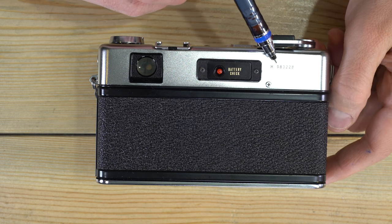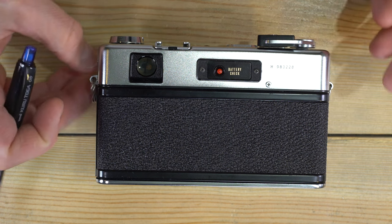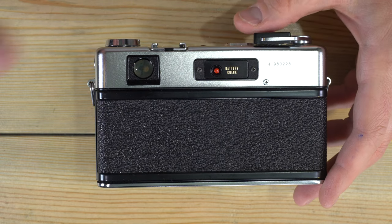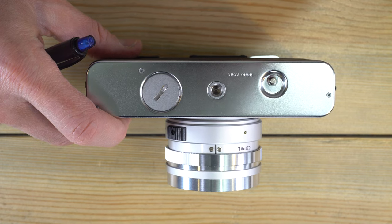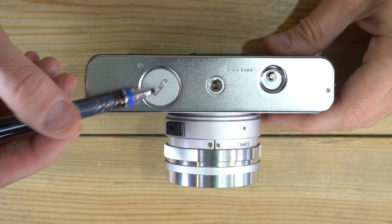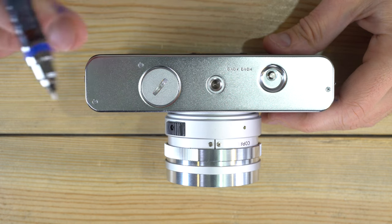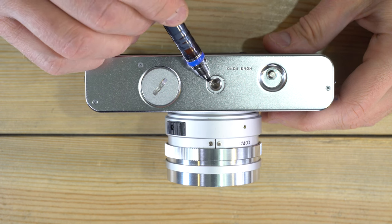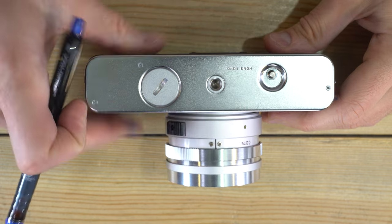The serial number is a unique identifier for your camera. On the camera's bottom are the battery chamber, the tripod socket, and the film rewind release button. The battery is kept in the battery chamber, you attach a tripod to the tripod socket, and you push the rewind release button before rewinding the film.